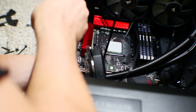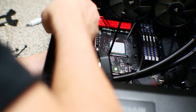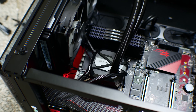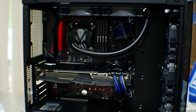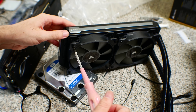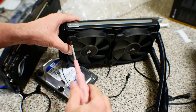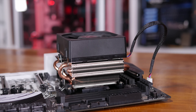Just a little FYI: if you are buying a cooler on day one, make sure that it fits AM4. If not, and you can wait a little bit, I'm sure a lot of the cooler manufacturers will be bringing out brackets and hopefully sending them out for free if you already have an expensive cooler. The bigger air coolers and also the all-in-ones tend to bolt down, so these are the ones that will generally have the compatibility issues because you need those AM4 holes lined up.